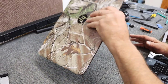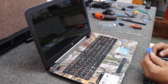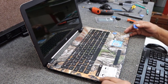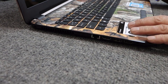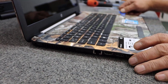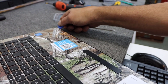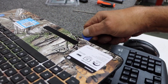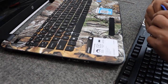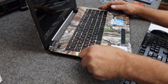Now I'm going to flip it back over. I'm going to use one of my spudger tools — I'll have a link below where you can buy these on Amazon, they're super cheap but very handy. There's a seam along the top edge where the bottom pan meets the palm rest and keyboard area, so we're just going to slip it in and gently work it around, keeping it underneath if you can. You can hear it snap and that's good.